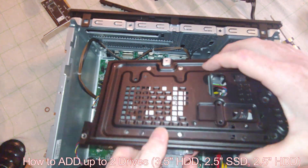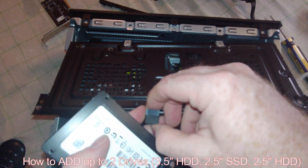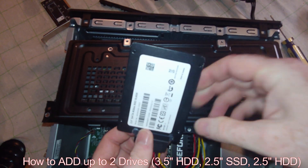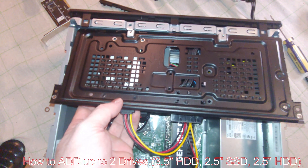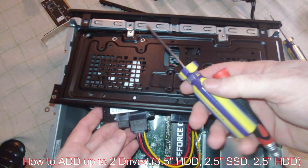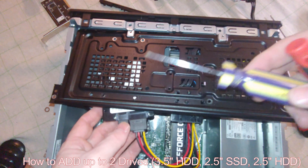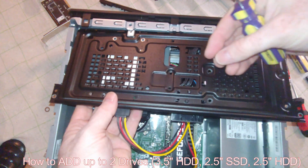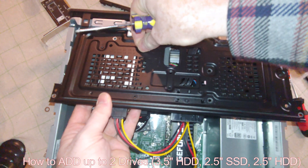The other part is making sure that you plug your SATA 3 cable in. So we would make sure we did that. Now that I've done that, I can go in and put that in place. Normally you would use an electronics screwdriver — like this orange one, which is a number zero. To finish this off, we're going to go ahead and put that screw in.